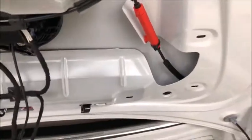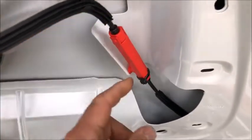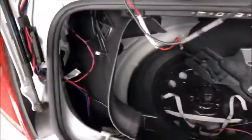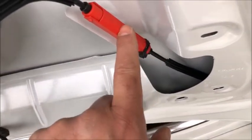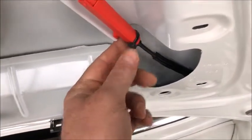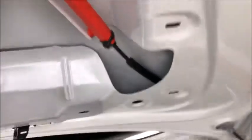Make sure your trunk emergency release is connected properly — I never even knew I had one. I had unplugged one of the wires here to get more slack when feeding wires in, and this morning I couldn't open the trunk. The emergency trunk release is right here — you lift this up and there's a rope you yank on. The problem was a red connector with a steel cable and a ball that connects to another piece had popped open. I was finally able to open the trunk by crawling in through the back seats.